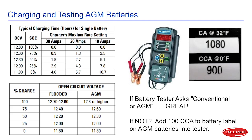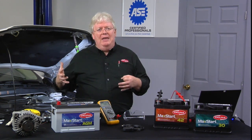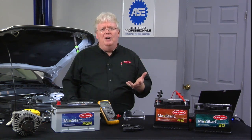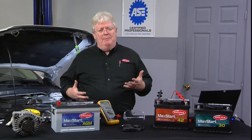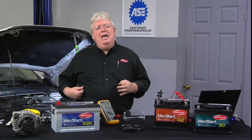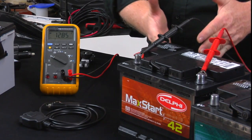The chart on screen shows how long you'd need to charge a battery that reads 12 volts when it should be around 12.75 to 12.85 volts. At 30 amps, you'd need close to three hours; at 20 amps, over four hours; and at 10 amps — like a small tabletop charger many shops and do-it-yourselfers use — you might as well come back in the morning. Charging time depends on what the charger outputs and what the battery can accept.